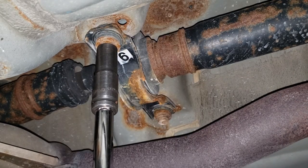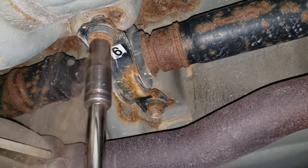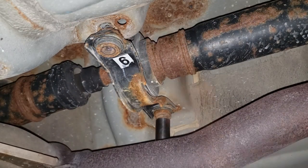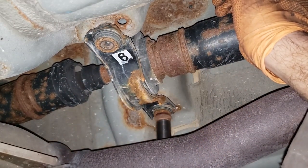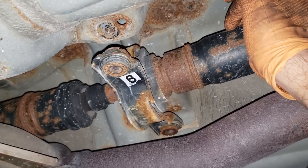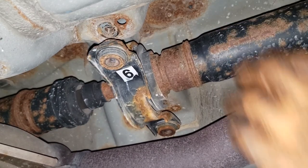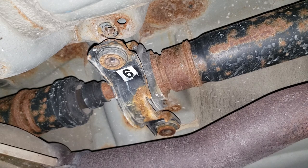It's very rare — I've only had one break — but it can happen. We're good to go on that one. Now support the shaft and you can slowly let it down. That joint is pretty knackered — yeah, that's bad. It didn't even want to come down — that's how bad the other joint is in the front. That's never a good sign, so we'll explore that later on.